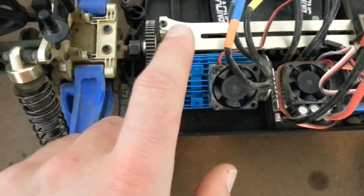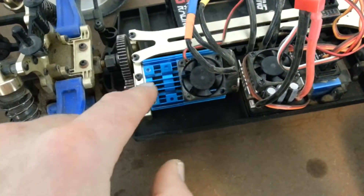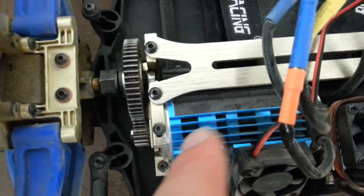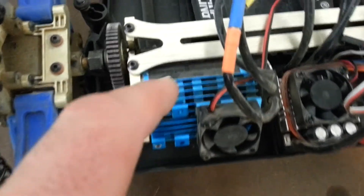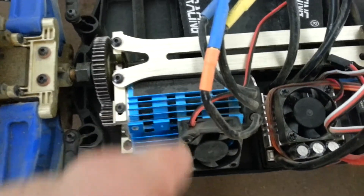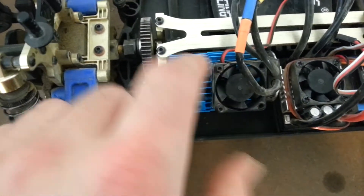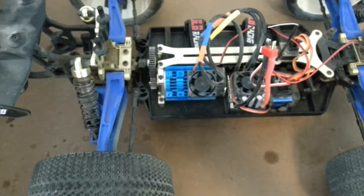This here is two heat sinks. Both of them come with a fan like this, but obviously they didn't fit both of them in there — so I couldn't have two fans on there, which is no big deal. What I've done — I actually had to cut some of this one off, removed the fan, and cut it down so it just fits in perfectly. Then I stuck tape on either side so all the fins run horizontal and fit in with each other. The fan is pushing air in and going in between all these fins right back here, acting like a much better heat sink. So one fan's doing the cooling for the whole lot.